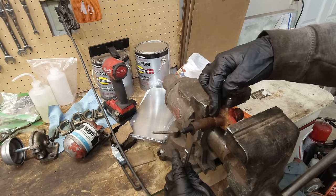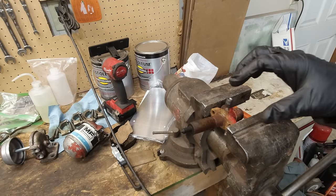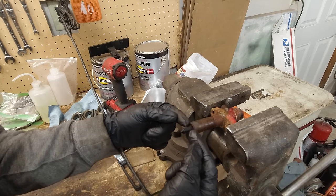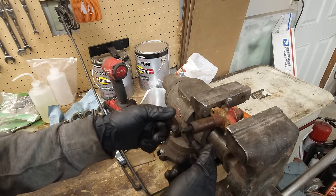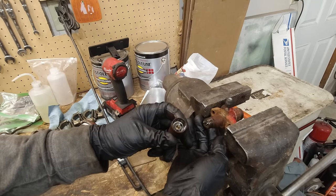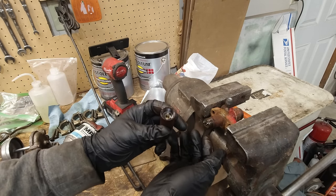So there is no O-ring that goes in this little groove. That is quite literally just the opening where these meet. And there's no reason for this to be sealed up here anyway, because this copper crush ring down here is what seals all of this. And then you get all of this on the inside. So now let's go over here and I'll show you what's in here.